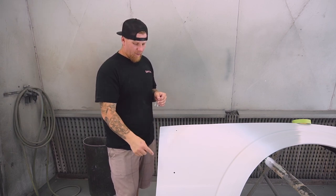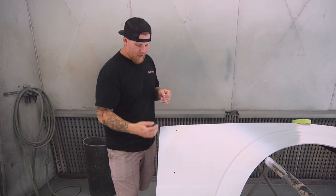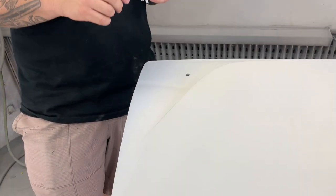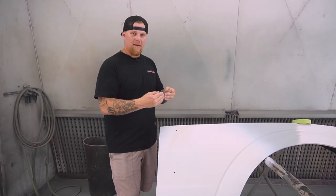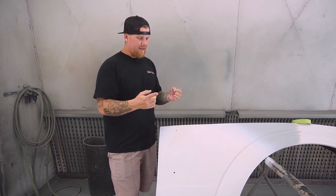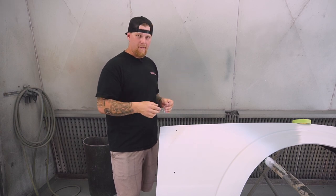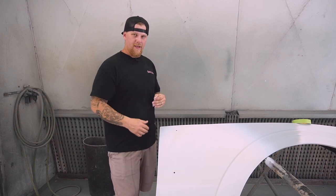At this point, it's very faint to see this line that goes around the perimeter of this logo, but you need to make sure that you have an eighth inch to a quarter inch of separation. The reason is because we're coming back in with, quote unquote, the negative return for this lighted circuit. If you had the back plane overlapping the very first coating, which is the same material, and they're both conductive, it's going to have a short if your dielectric is not thick enough, or you had an area that you missed, or whatever it may be. So it's always better to be safe than sorry, and do your quarter inch separation.